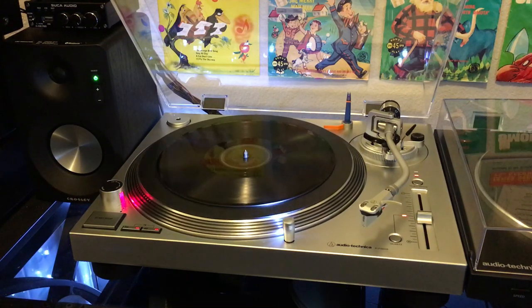Back to the topic at hand — how to properly play a 78. We're going to be using a wide groove stylus. A micro groove modern LP record has a narrower groove width than an old shellac 78, which has like a three mil groove, a wider groove. You technically have to use a wider groove stylus and cartridge combination to get the most out of that sound. Otherwise, the fine point micro groove stylus is going to ride down the middle, not get information off the sidewalls, and pick up a lot of noise. Even if it's not damaging anything, it's just not going to sound as ideal.